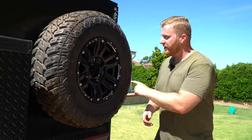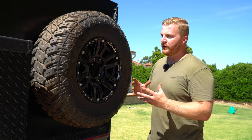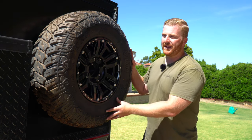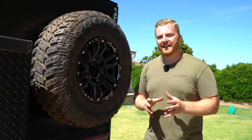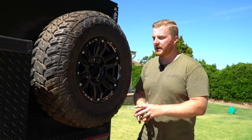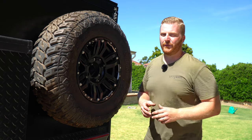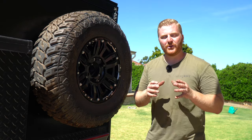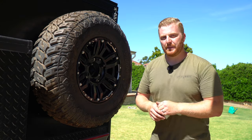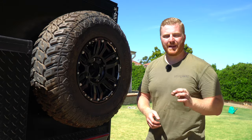While we're on the subject of tyres, make sure to check your spare wheel — it's just as important as the wheels on the ground if you need it in case of a flat, and it's a very easily forgotten item on a service checklist. Trailer tyres are often mounted on the back of trailers, fully exposed to all of the elements. If it's been sitting out here for a few years without use, there could be UV or heat damage. So give it a once over, make sure there's no damage to the wheel or tyre itself and it's still holding pressure. Also make sure these wheel nuts are done up firmly — we don't want this wheel falling off down the highway — but not too tight. We had an incident where we ended up snapping the head off one bolt and almost couldn't get that spare wheel off when we needed it.